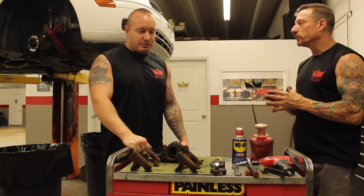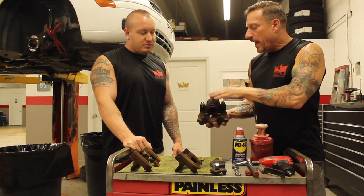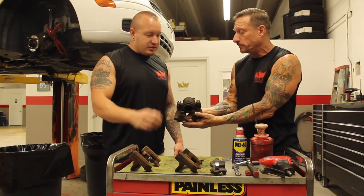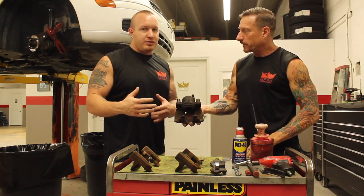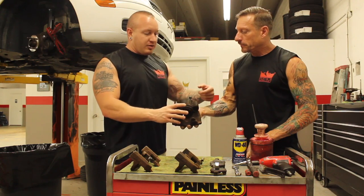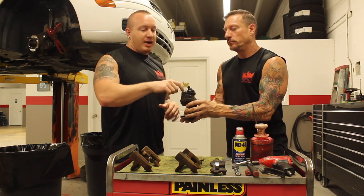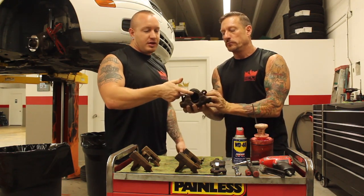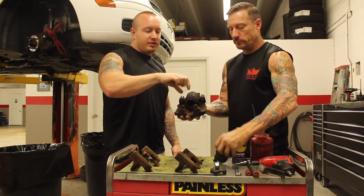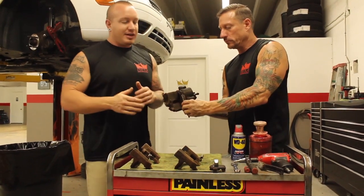So let's talk about why it's so important to do a thorough brake job. On this particular model we had a caliper lockout. This is the caliper itself — could you please talk about what I'm holding and how this functions? So just a brake caliper, very simple design. A lot of people think these are very complex — they're not. It's nothing more than a cast iron caliper. You have an inlet side which is your brake hose, where your brake hose screws in and supplies brake fluid pressure into the backside of this round bore, which is your cylinder and your piston. That's sealed with an o-ring on the outside and one also on the inside, and that just creates brake pressure behind that piston. The piston pushes out when you apply the brake pedal and squeezes the brake pads down onto the surfaces of the disc. And that's what slows your car down.